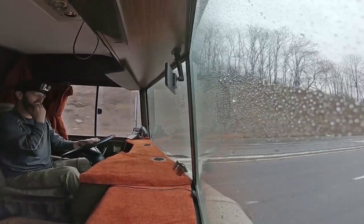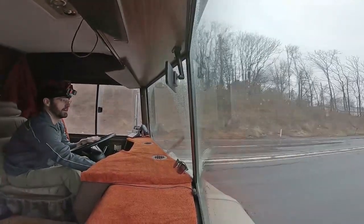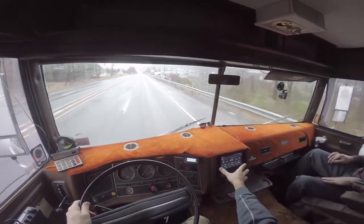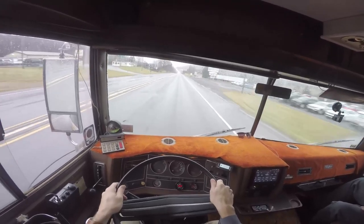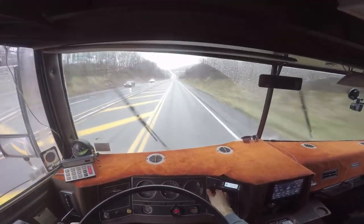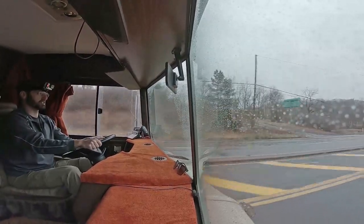The reason it gets loud is it's an open wastegate in the crossover. So when the wastegate opens, it's basically open header. That's why it gets loud. Do I have engine management stuff in this head unit or is it just audio? It's audio. It's a stock ECM, so there's nothing fancy. All right, there's where some of the shake comes into the wheel. Yeah, the wheels are bent. Just ride it out. It's just fine. This is a very, very firm accelerator pedal.